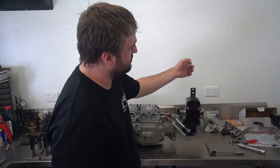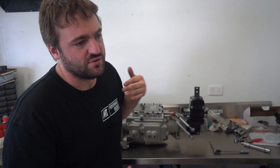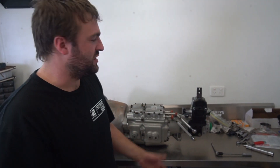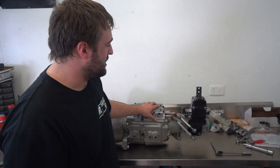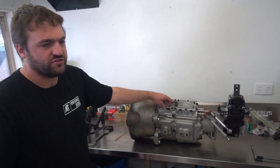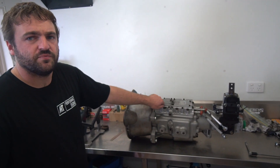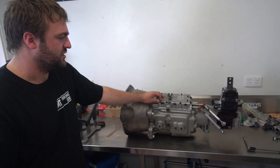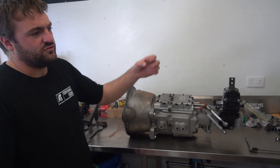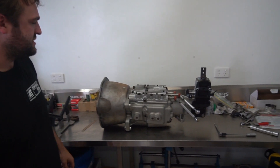If I mount it to a shifter, when you put strain on the shifter as it bends, it registers that I'm trying to make a shift. Then I can induce a cut into the ECU which will allow flat shifting without lifting the throttle. Being a dog engagement gearbox, she'll have shifts at 0.4 seconds or less. No clutch - completely clutchless shifting, flat. Just keep your foot flat on the accelerator and as soon as you pull, it will induce a shift cut and pop into the next gear.